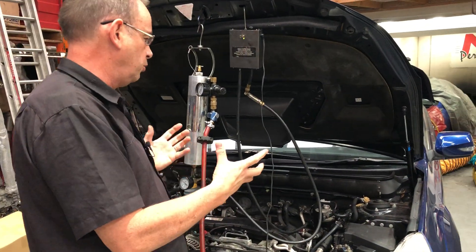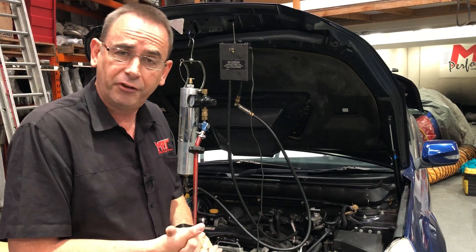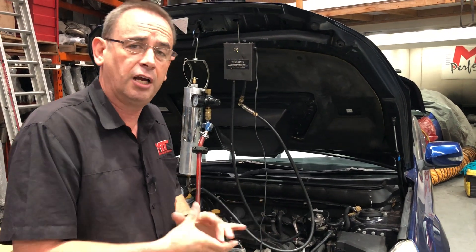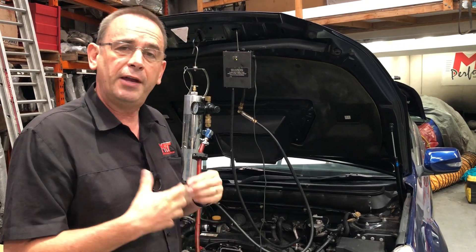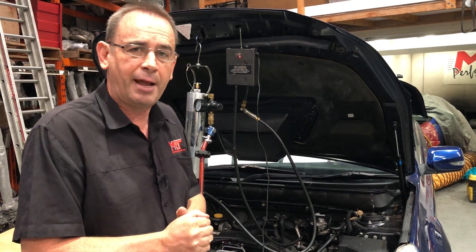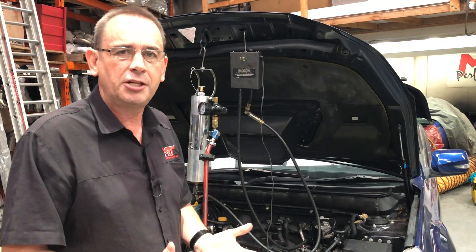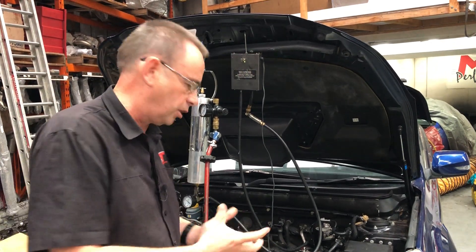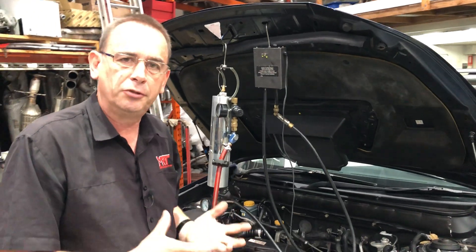What we do is a diagnosis to confirm the problem first, which is a specific fault code through the diagnostic scan tool of the engine ECU. Then we road test the car to make sure it is working or not working in the correct parameters. We also check things such as soot buildup, ash ratio, and oil dilution — these are all common problems or wear and tear issues on Subaru turbo diesel.